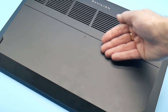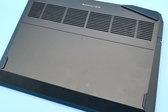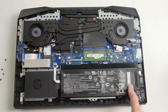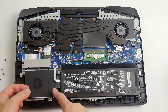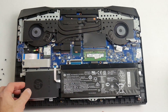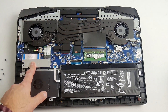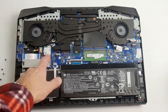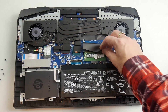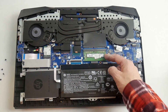The back panel is held on by Phillips head screws and has a large air intake for the two fans to suck in air. Inside you have a 52Wh battery which gives you 4 hours 50 minutes of run time. Adjacent to that there is an open 2.5-inch drive slot for which they supply the necessary connection cable. Above this is the single NVMe M.2 SSD slot as well as the Intel 9560 WiFi card. They do have two RAM slots but only one is occupied.